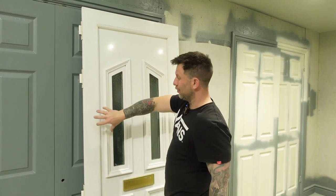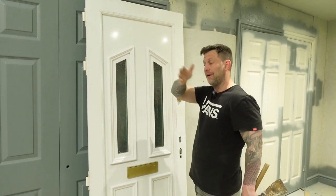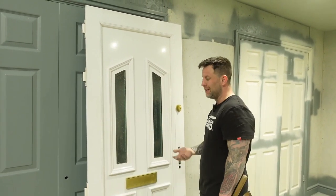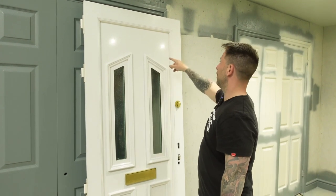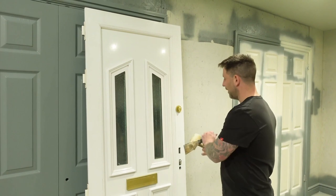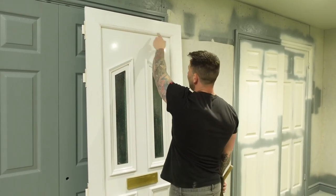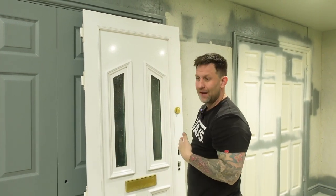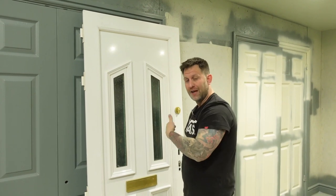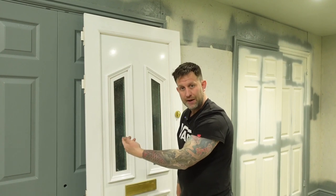The back of the door, which should be inside the property, will be the panel that comes out towards you. Take your door off - it's a bit easier depending on which side you're doing. What you want to do is take the panel out completely. Take your beads off all the way around, then spray the outside of the panel, pop it back in, and then spray the whole door uniform together. So if the panel does move, it's not going to show a white line because it'll be sprayed behind there.